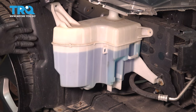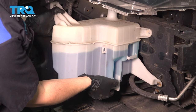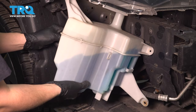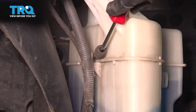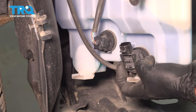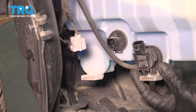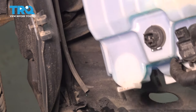This is obviously still full of washer fluid. If yours is already empty because it's broken or whatever the case might be, that works out for you, but I have to be careful not to spill too much. So I'm going to take this off of that stud, and then on the backside is where all the wiring is — once I pull it away a little bit, I can have access to it. Right here I have this retainer for the wiring harness — I'm going to pop it through. Get this hose off, unplug the pump and the level sensor. When I pull this hose off the pump, it's going to leak, so I'm going to plug up the pump side really quickly. The hose will not leak — and there is your washer tank.